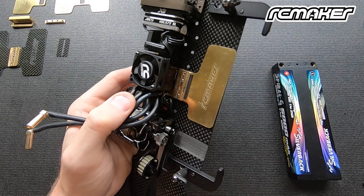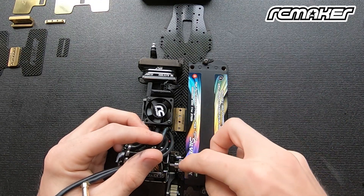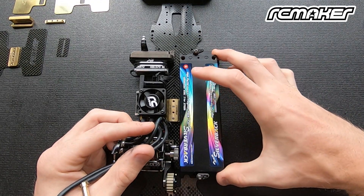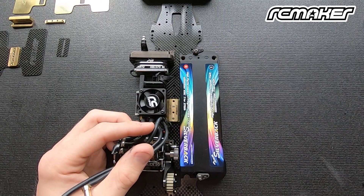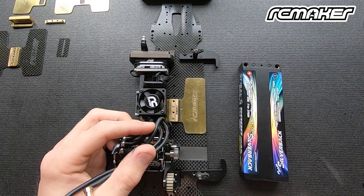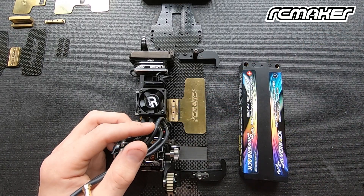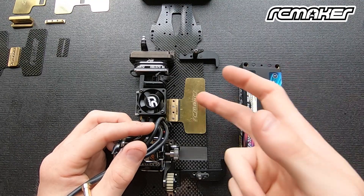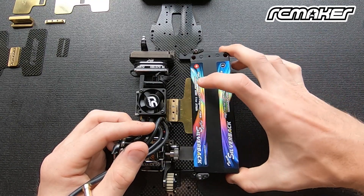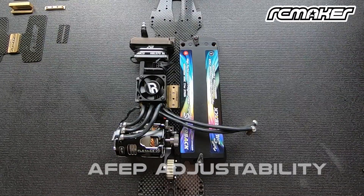For the Automatics, I've also created a little battery stopper using the screw that goes into the motor mount — the further forward screw — and you can adjust that. It's really nice because it stops the battery from hitting your pinion, which can often be quite close. For most cars using the standard center weight, you're going to have two screws coming out there that you can adjust yourself. If your car depends on the center weight as a battery stopper, I recommend using some nice thin foam to pack it up until you're happy with how it comes out.